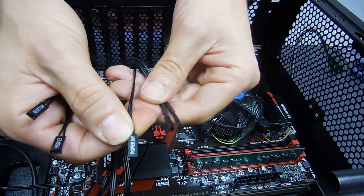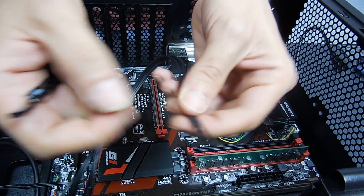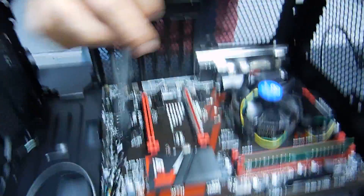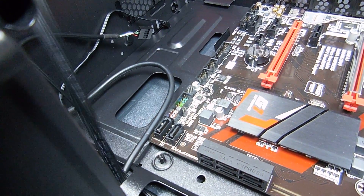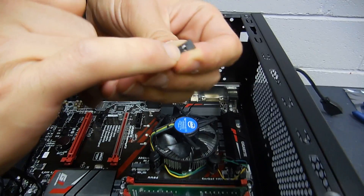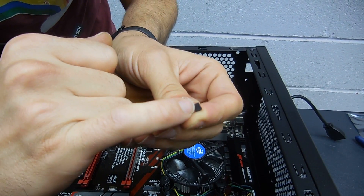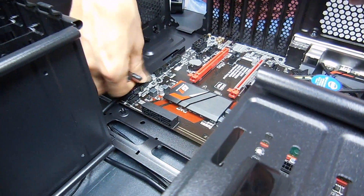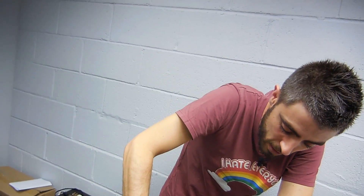The power LED flashes when your computer is on or off. This can be a bit complicated, but you can find all the information on your motherboard for where to connect these pins. I usually start with the reset, which is here in green. It's different for every motherboard, so check your manual if you're not sure — or this YouTube tutorial. There's a little arrow representing the plus, so always match it with the positive plug on the motherboard.